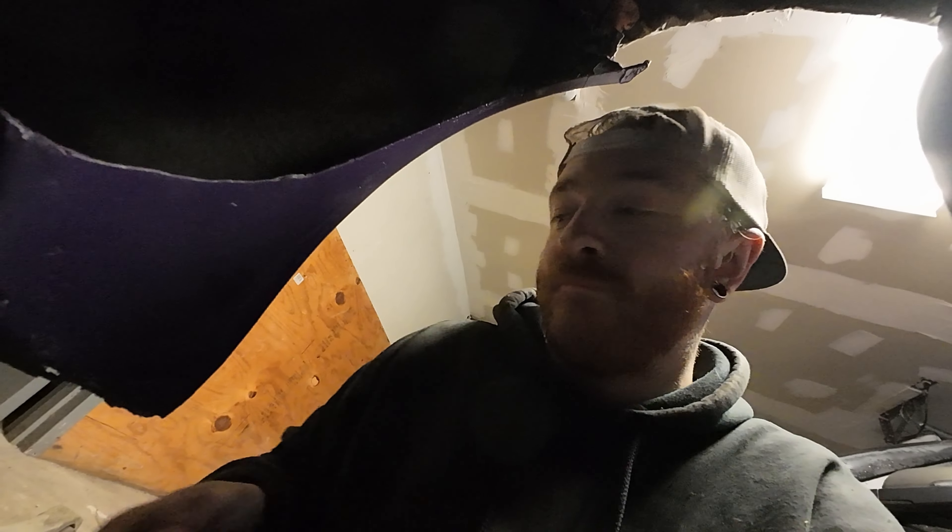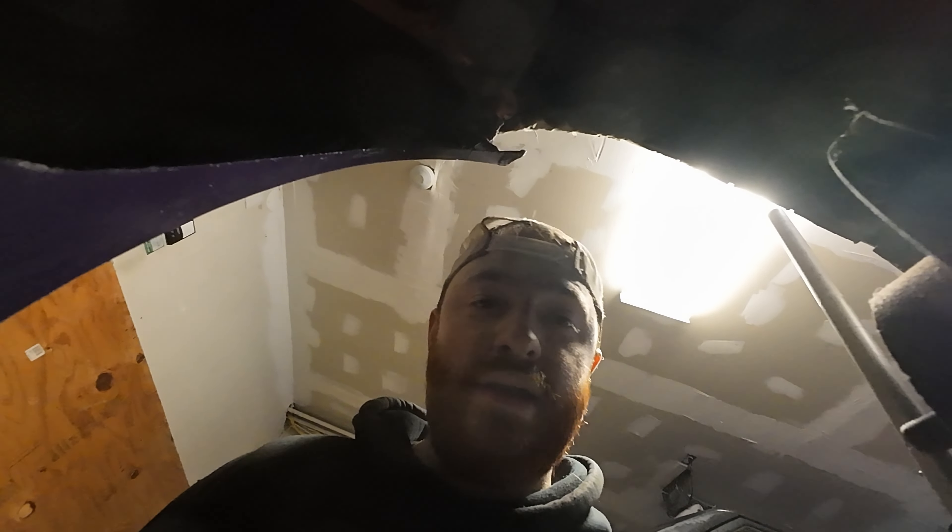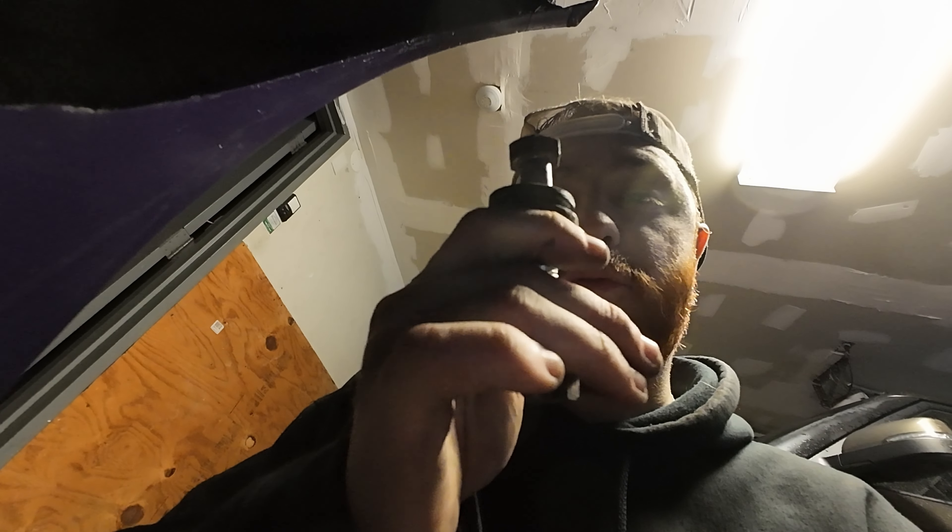It's definitely better to have fully adjustable arms. I'm guessing you can probably get quadruple the amount of adjustment just from going to lockout bolts and an adjustable arm — maybe even more. You could probably get to like 20 degrees of camber if you really wanted to. With the FDF mega mantis kit, if you're a stance guy you could do that, but the car drives horribly — I accidentally did it when I first put it on and it was the most unsafe I've ever felt a car drive. Don't do that.